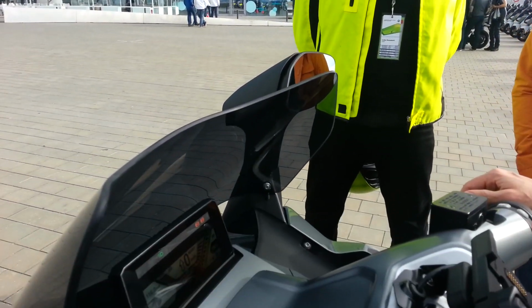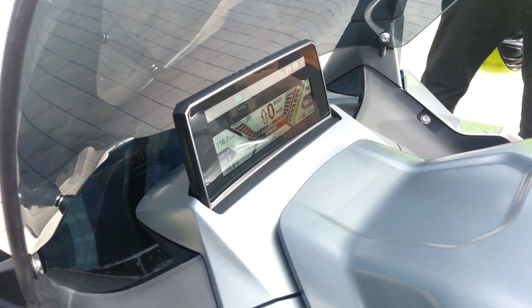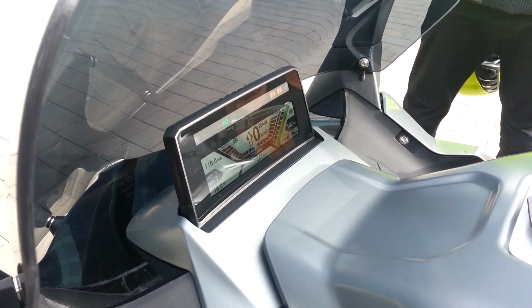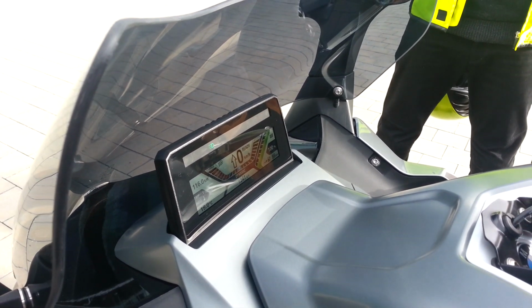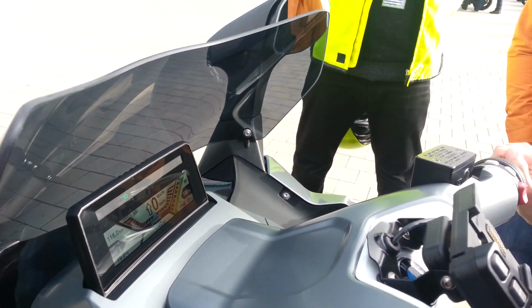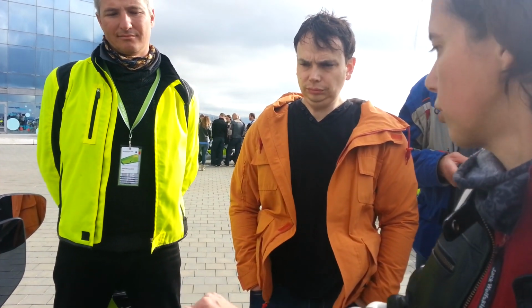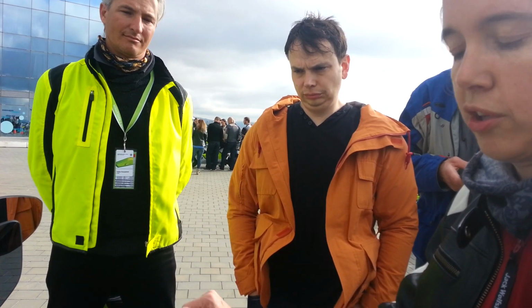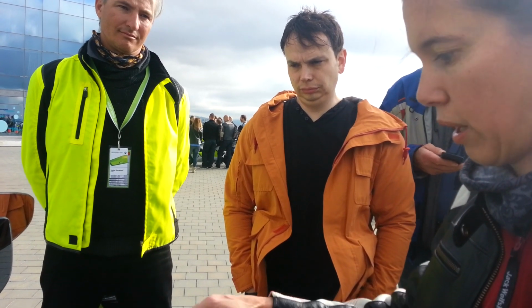Next one is the dynamic mode. There you have full engine brake. That means full energy recovery and full acceleration power. In urban traffic, that more or less puts you in the situation that you can follow the traffic without touching the brake levers, because the engine brake is strong enough to decelerate. I find that one of the most practical modes in everyday riding.